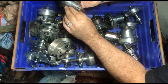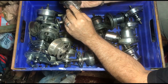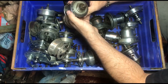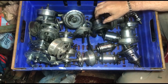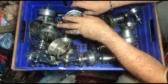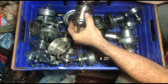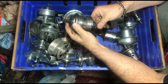Now this is the smooth shell and it's April 1956, an AW three-speed, 40 holes - it'll have come out of a roadster. British bikes used to have 40 holes in the rear wheel and 32 in the front as almost a default. Continental bikes were usually 36-36, and eventually the British caught up and fell into line with the rest of the world.